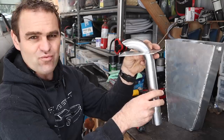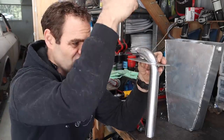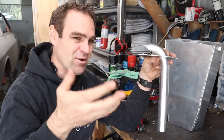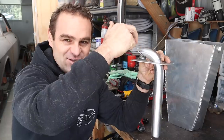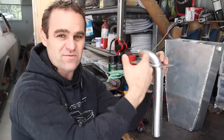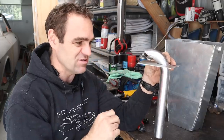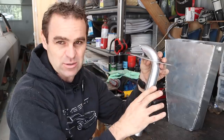It's at just the right spot so that it's going to sit like that in the bottom of the tank. The reason for this is instead of just having a hole in the bottom, on the off chance that there's anything heavy or metal coming in the oil tank, there's a chance that it's going to sit on the bottom and not go back into the engine. So I've got this sort of protected here, so anything falling down will hopefully sit in the bottom of the tank and not get sucked back into the engine. This is not the only part of filtration, but that's the theory behind it.